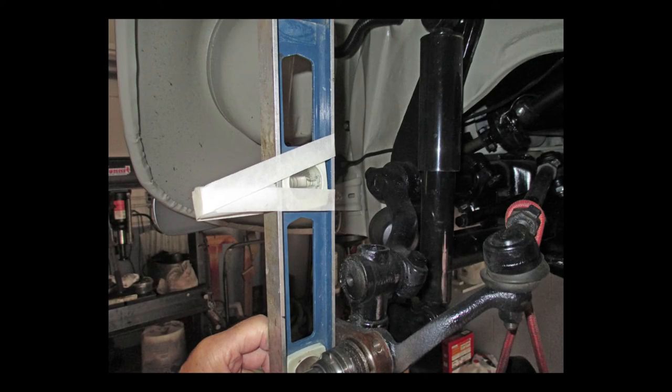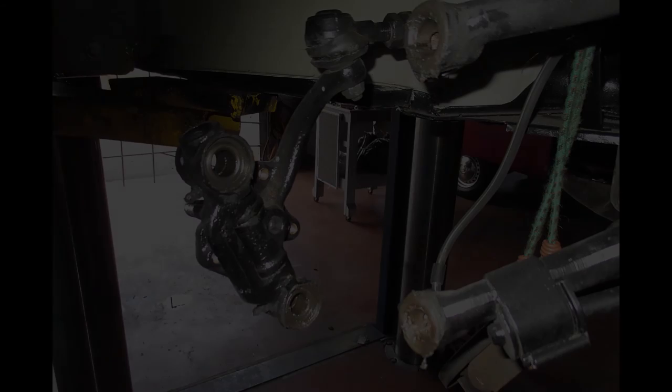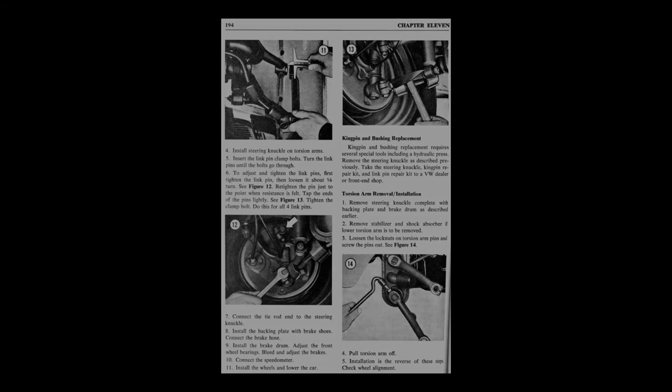What I'm shooting for is just to get the wheels perfectly vertical, and as you can see by the level bubble here, they aren't. To remove the upper and lower link pins, you must completely remove these two bolts as shown here - they run against an adjustment groove on that link pin, and you cannot take the link pins out because the bolt captures the link pin. Once these two bolts have been removed, you can take a small punch and tap that link pin out. I'm a fanatic about marking things the way they were, so lay these out so you'll know exactly which link pin goes where. This photo shows the lower torsion arm loose from the spindle - the link pin has been removed - and here the spindle is completely removed.